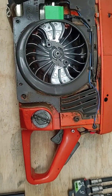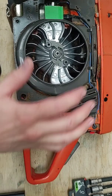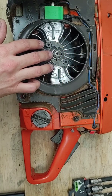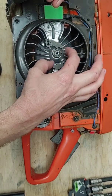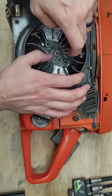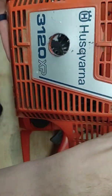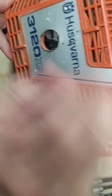I figured this out because it was just killing me to pull-start this thing every time. The first thing you need to do is remove the flywheel cover and the recoil starter. It should have some pawls here that catch on to the recoil starter, and you'll want to measure the space required on these to know what size hole to drill in the side of the flywheel cover.